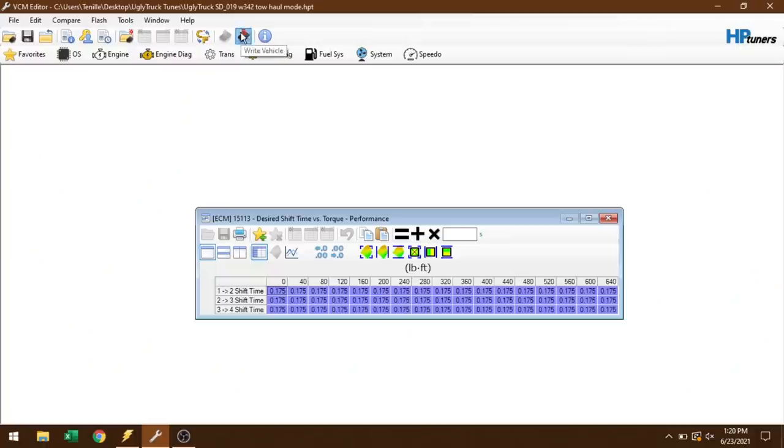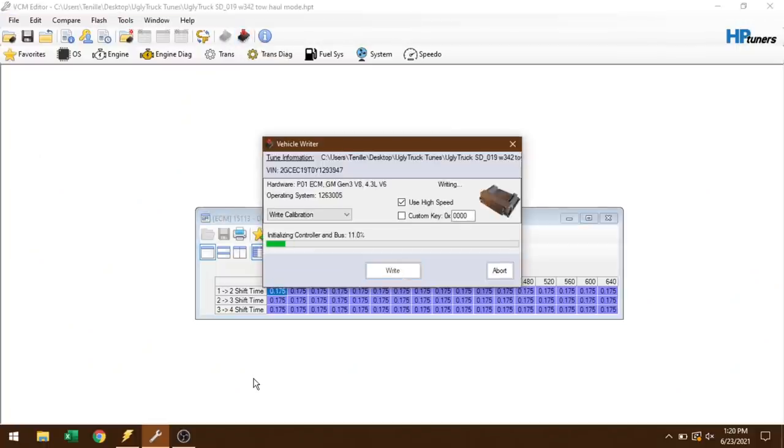But for now, let me just get this tune flashed onto the truck, and we'll just take it for a quick test drive, really to make sure that the tow haul mode is doing what it should. So to verify function, all we're going to do is just take off. I have tow haul mode engaged, and basically the transmission should not shift until we get to wide open throttle. So here we go